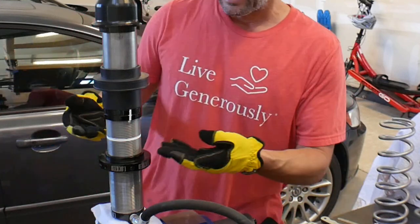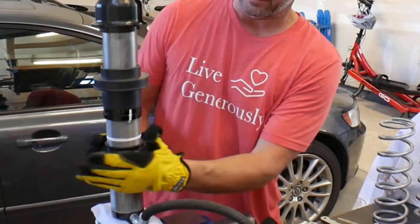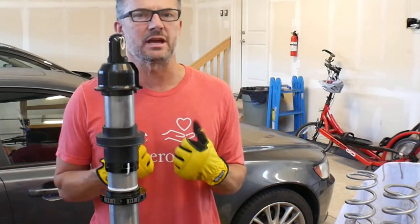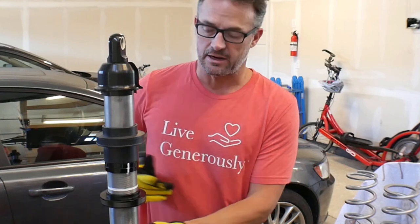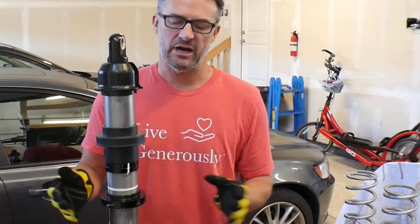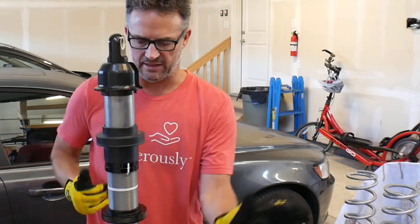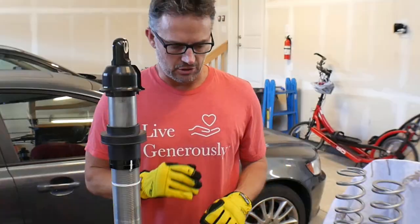That's just a visual reference line. Honestly I don't think I'd ever have it adjusted that far, but you never know. I'm the kind of person who really likes clear markers and identifiers. If I'm at the track and I can see that line, as long as I know the rings haven't slipped and I don't go beyond that mark, I'm not going to be binding any coils. If you change the coils, just take some acetone, wipe those lines off — no big deal.